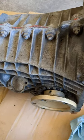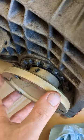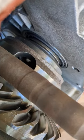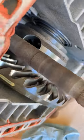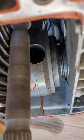Anyway, I want to run something by you. When I kind of push in on the yoke here, you can hear it click click click click. But if I kind of pull out on it — because there's a little bit of play — it's a lot smoother. So that would be the driver's side.